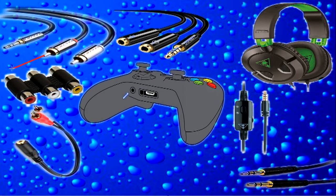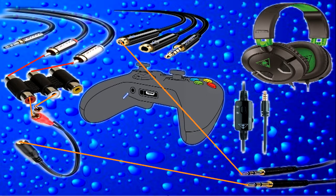We're going to go from those two cables here to this bridge thing, and then another two cables to a female 3.5 millimeter cable. That female cable goes to a cable that has two male ends on it, and preferably they have to be three rings, or sometimes two rings. This last one has to be a three ring though, and it has to be able to go into your microphone port on your headphones if you have a detachable mic.